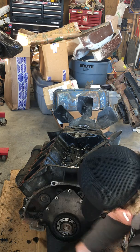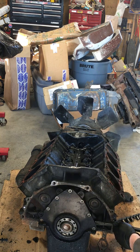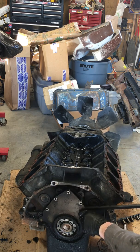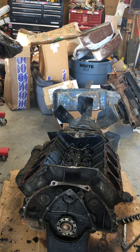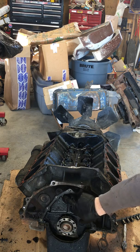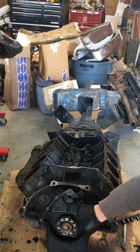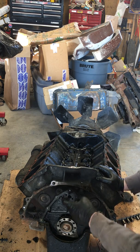Now there's one interesting thing about these that you're gonna see as soon as I pop this baby off. Be very careful not to damage it. All right. There is no cam rear cover like on a gas motor. This is the cover, and any oil that comes up through that bearing just goes right back down and keeps that lubed as well. So I just thought that was very interesting the first time I took one of these apart. That is the cover for the cam as well.